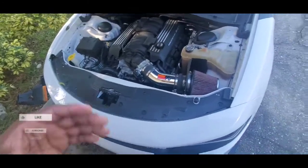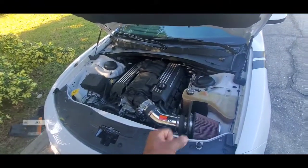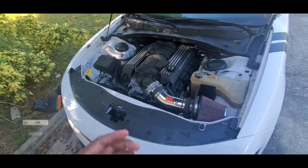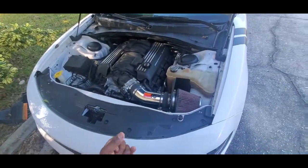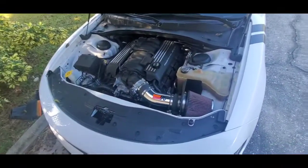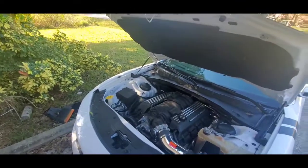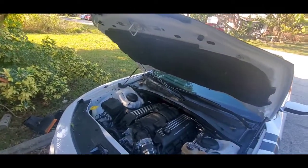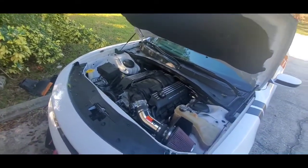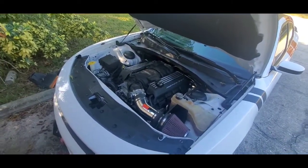And by my valve springs being broke, your rods don't have nothing to rebound. Your rods is going up and down like this, and your rods is rebounding off those springs. And if it didn't have nothing there to rebound off of, the rod was actually hitting the piston. So the rod hitting the piston smashed my rod, because he said my rod was smashed. It was smashed, and then by the rod being smashed, it ended up messing up some lifters, which is kind of like up under that. So this was all internal stuff that happened, you know.